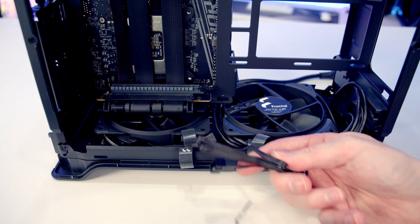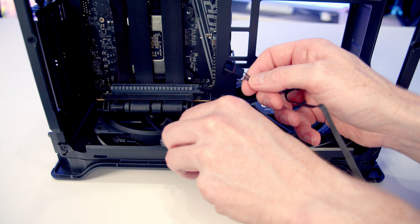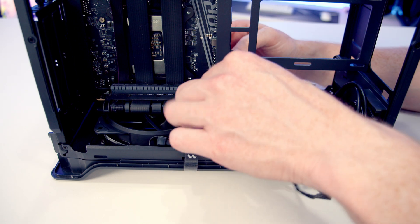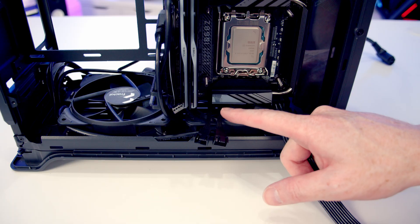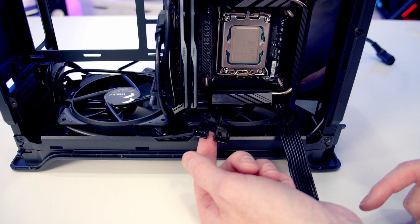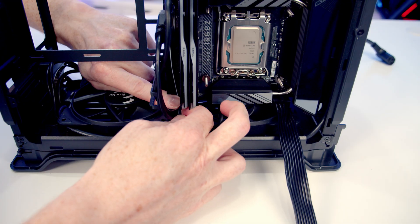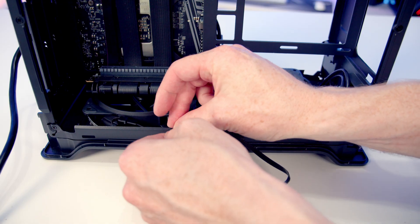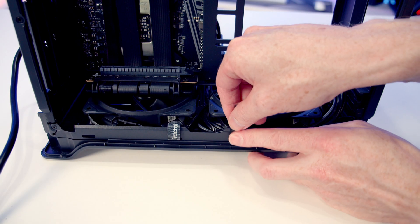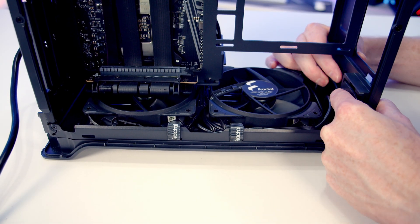Free up the fan cables. One fan cable stays pre-managed while the other plugs into the splitter cable coming from the first fan cable, then pass it through to the front of the case. The cable adapters plugged in earlier are useful now — take the one on the left for the system fan header and plug it into the PWM cable. Tuck excess cable through to the back, replace the Velcro cable straps, and wrap the excess fan cable and front panel connectors together.